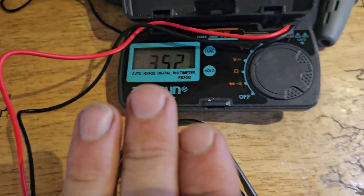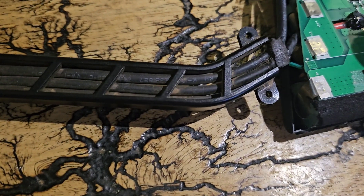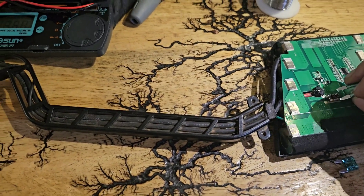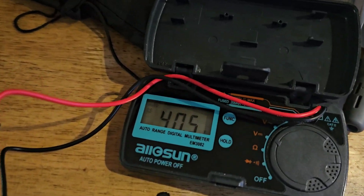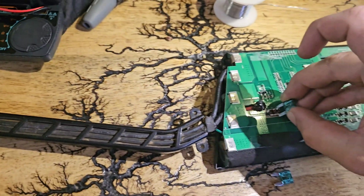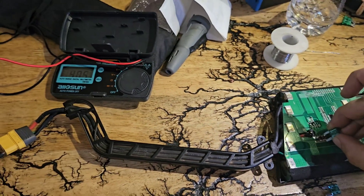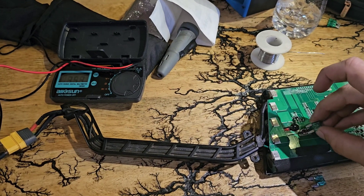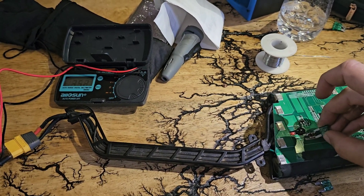So say when I put it back to voltage — I'll stuff that in there. Alright, so 35 — still not working. If I connect that properly — look at that — 40 volts. So it is blown fuses. When I disconnect: 35. Connect: 40.